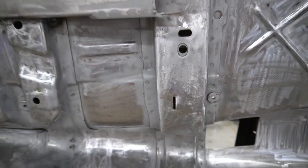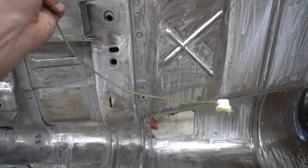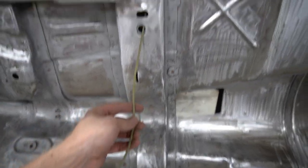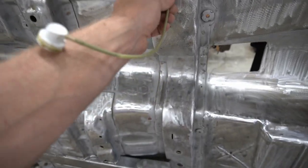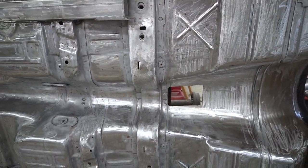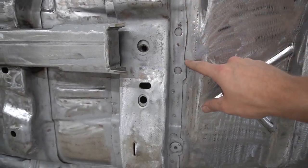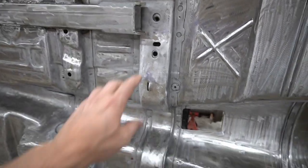The other thing I want to mention is — you can see some green in there — I used Eastwood's internal frame coating. Basically you have this two foot hose with a 360 degree spray end on the end of it. What you do with this is you feed it up through these areas that you can't get to. Then this end goes on the spray can and basically you start spraying frame coating and then just pulling it out nice and slow. What that does is it'll get all the insides and cover it with some rust protection. Being that the car is on its side, that internal frame coating kind of came out the sides and ran down these areas here, so I know it got some coverage in there as well.